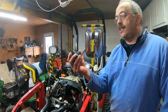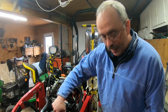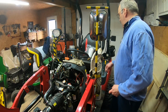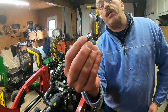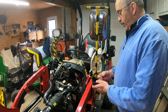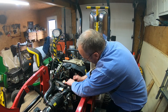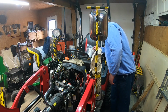So this is the holder for the catch tank, and what is nice is that the bolts are already welded on the plate here. I'm going to bring the camera closer. These are 12-millimeter bolts, and remember, you need a flat washer, a lock washer, and the bolt itself. So I'm going to install that like so. Where's the other bolt? Right here.